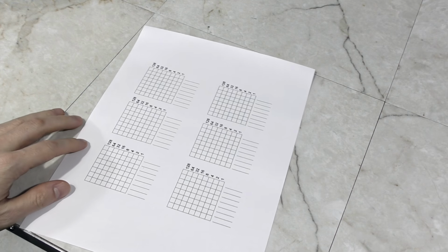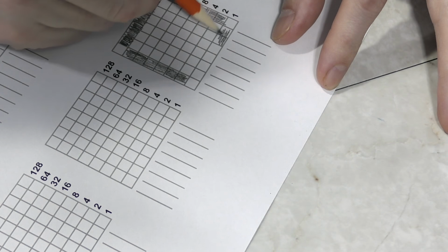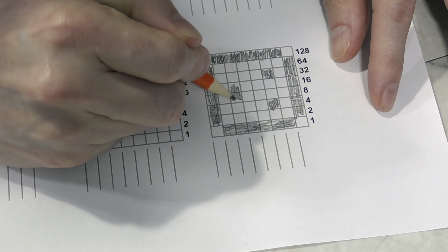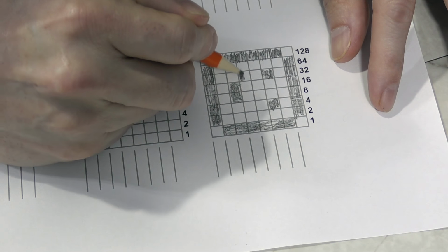So what about graphics modes? Well, technically it doesn't have any, like none. However, you can redefine the character set, which is something the PET could not do. So, if you were writing a game back in the day, you could take a piece of graph paper and design out different shapes. The characters are 8 pixels wide, so each row works out to 1 byte of data. So if I wanted to replace the character O with a smiley face, I could do that, and now when I type an O, I'll have a smiley face. This was very handy for creating simple games.